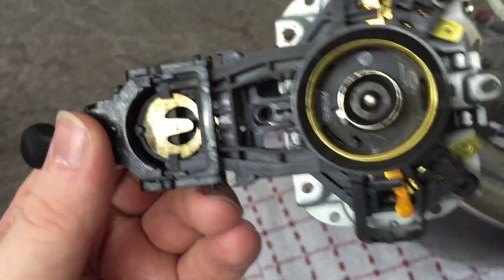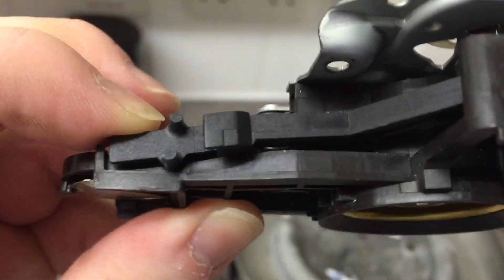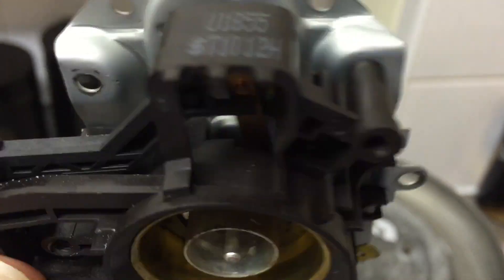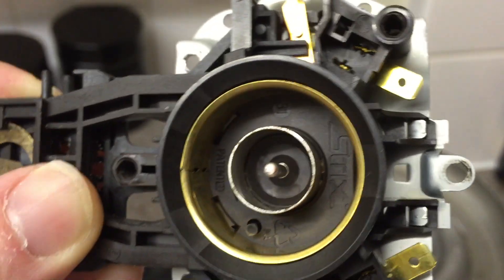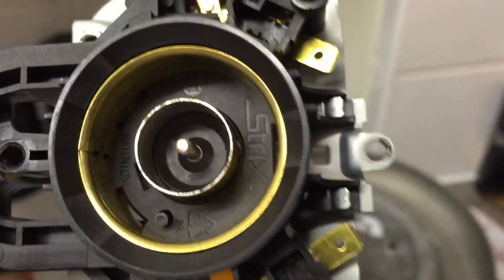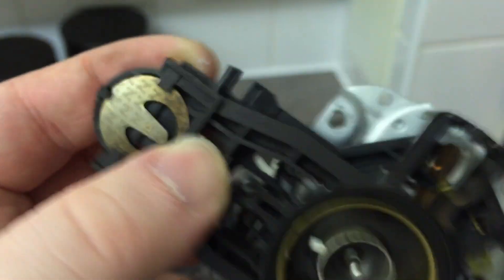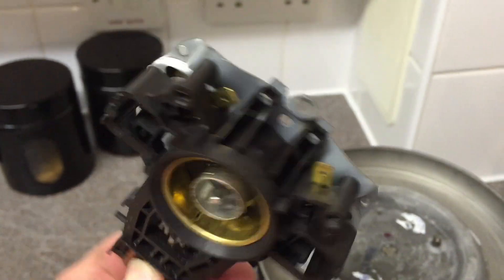That changes and pushes up the switch to switch the kettle off. The mechanism is quite badly damaged. What normally happens is you push this switch down which would latch in place, pushing these contacts together making the circuit to the element from the input. And then when this gets hot it springs up, changes shape, pushes this back up and then switches the kettle off. Fairly simple.